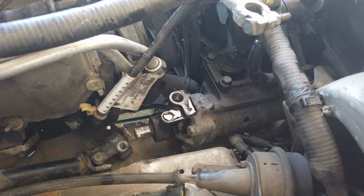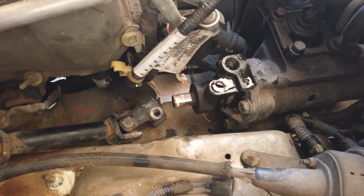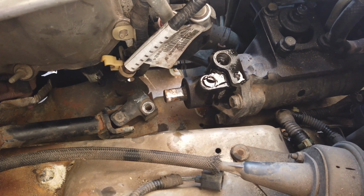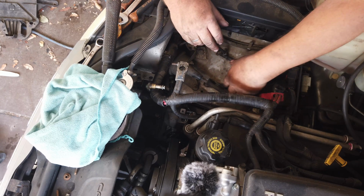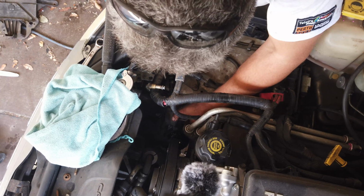Okay, having removed the battery tray made this job a piece of cake. Removing the two hoses, the steering rod came off easy as pie. So now it's just a matter of the 4 bolts in the wheel well that bolt through the chassis into the steering box. So wish me luck to undo those. They're an 18mm. Got some friends here with a car. I may just go to the shop and get an 18mm socket. Okay, I got the bolts out, and yes, they were 18.